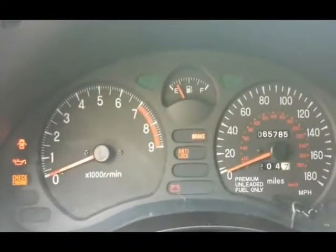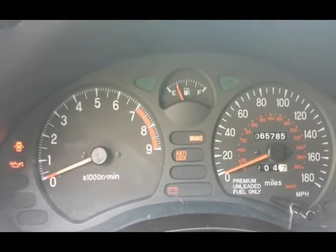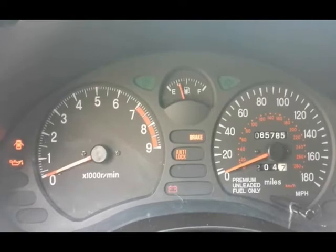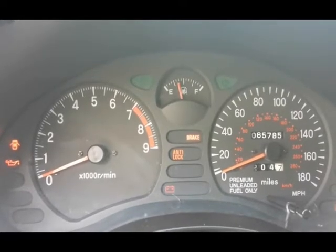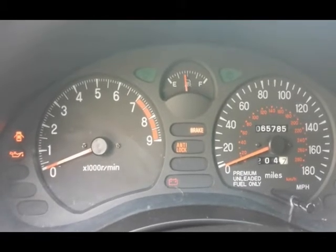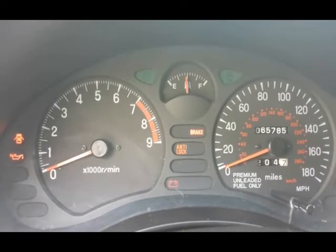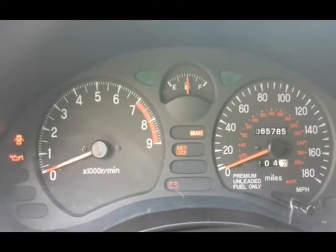Okay, just pumped out the 91. Put in, let's say 12 gallons of, no, 10 gallons of pump 85. As you can see, the fuel gauge is rising up. Should be over the half mark. I pumped out about the remaining, I don't know, 6 gallons of pump 91. And did the base tune for ethanol. So it should be golden. The only thing left to do is a pressure test and address the exhaust leak, which I've narrowed down to the rear. I believe it's between the DMP and the Tanabe. So we'll see how that goes. As you can see, it is settling right around the half point. So 10 gallons of ethanol, and just have to flash my base tune.